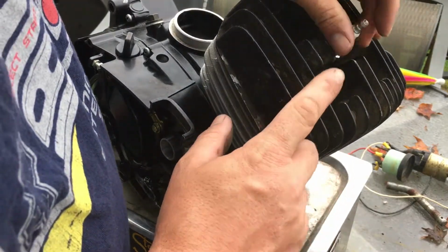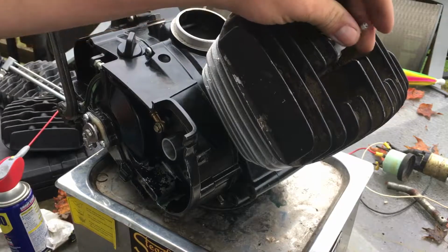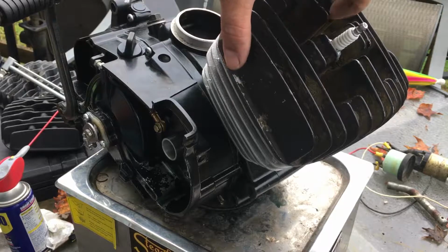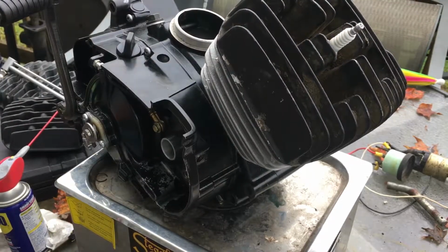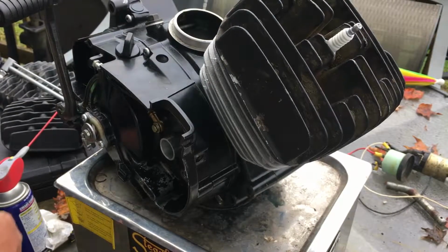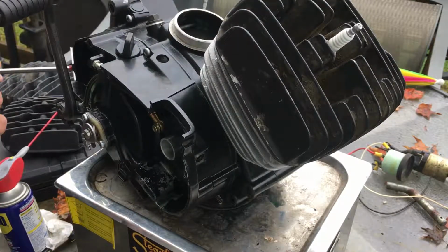the head bolts that belong on this particular head are regular nuts, flat washers, and lock washers. We're using the original KE100, so it's okay for a thread on each one to be exposed. I'm okay with that. More than 2, no, I'm not. But because the nut is taller, I can let that go. If it didn't have that, then I couldn't. But this is awesome.